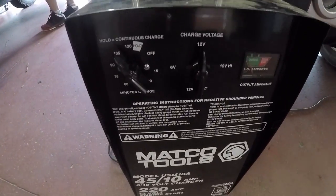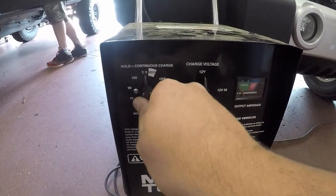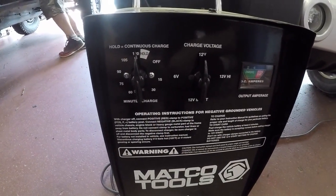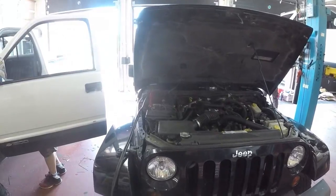The design of a factory alternator is to keep the charge on the battery up to par — it's not to charge a battery from dead. Hopefully you guys learned how to do a parasitic draw test today. I appreciate you guys watching, liking, and subscribing. Remember, crimping ain't easy — have a great day. Take your battery charger, stick it on 12 volts, set it for about 120 minutes continuous charge, keep an eye on it, and give it the best fighting chance you can.